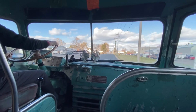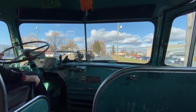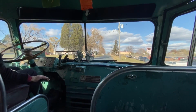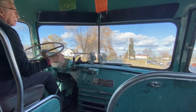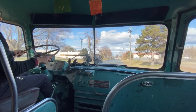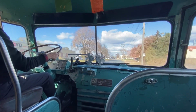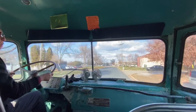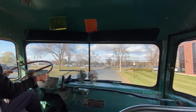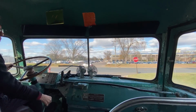When I floor it, there's no black smoke. How's the smoke in general back there? Is it smoking bad or is it just more than I like? Yeah, I don't want to see it smoke at all. It's blue smoke. That's oil smoke, not fuel smoke. So let's just hope they're in seat.